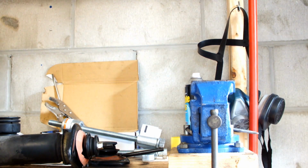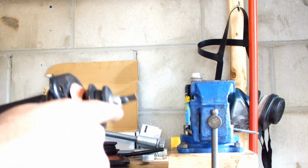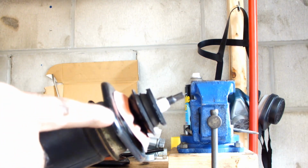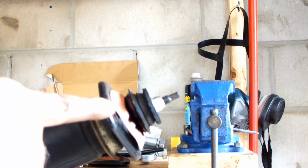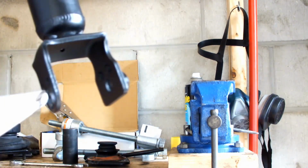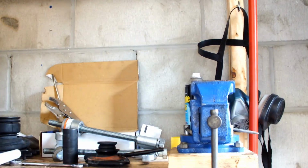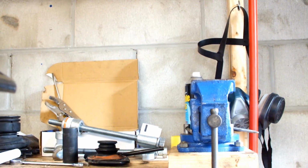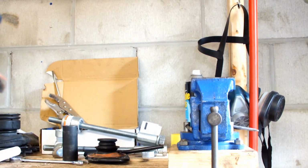Oh, I forgot to say, these bolts are 22 foot-pounds. These are 21 foot-pounds. Be very careful not to over tighten these, okay? And then the bolts on the bottom here are 81 foot-pounds. So I'm gonna put a link in the description with all the weights anyway once I make the video, or well, I guess by the time you're watching this. So let me install this one, put the other one out, and then do the same, and then I'll get back to you with the front.